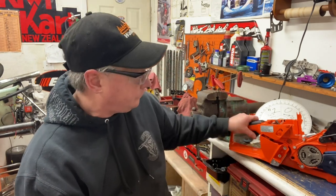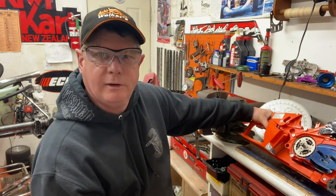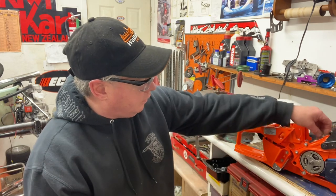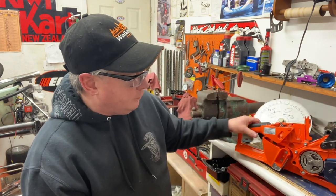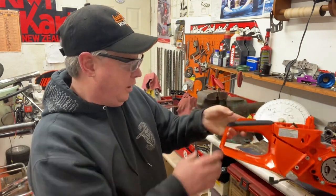Okay, back to this Echo, sorry about that. The oiler — I don't know how it puts out, we'll find out when we get the bar on it. I don't see in the parts breakdown that there are different mounts, softer or harder ones like some companies have. It's like Husqvarna's — the 372 heated versions come with standard soft mounts and the full-wrap non-heat come with the blue and white better mounts, the slightly harder ones that stand up better. We'll see how these ones work when we get long bars on them. I do have some bigger felling spikes from Gordy at West Coast Saws, and I'll do the muffler mod myself — they're pretty open on these, but I'll see what's going to suit the logger best and keep in compliance with forestry regulations with the screens.